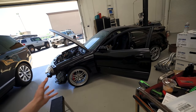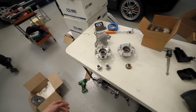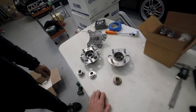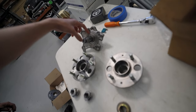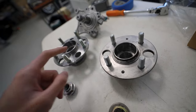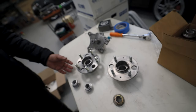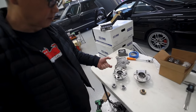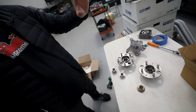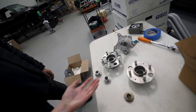You can see this car is five-lug converted, and we actually have a solution to a problem that a lot of Honda guys have been having — going from four lug to five lug. The common problem everyone's been having is the axle stub is too short. You can even see with the hub right here — the height of this is about half an inch thicker, about an 11 to 12 millimeter difference. The bearing itself is a lot wider. You can actually visually see it — this is a lot deeper. There's roughly an 11 millimeter difference, and you need that contact to use the bearing efficiently and properly.